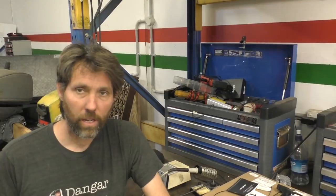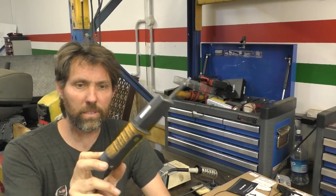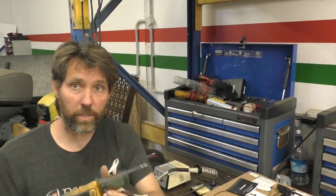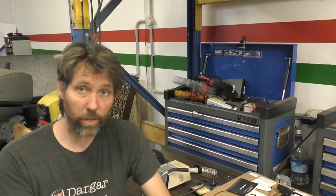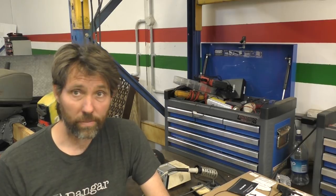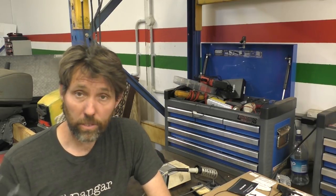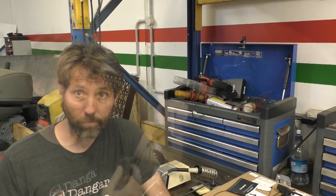Next one is electrical. One of my favourite things from the electrical box is this autoprobe style thing — actually a multi-function auto tester. You hook it up to the battery, touch the single probe to any point to see whether it's got voltage or a ground, and then you can use this button to supply voltage or supply ground. Really good for quick diagnosis — essentially the same as a multimeter, although a multimeter can't supply current, so I think it's better for testing. It's also a bit easier to use.